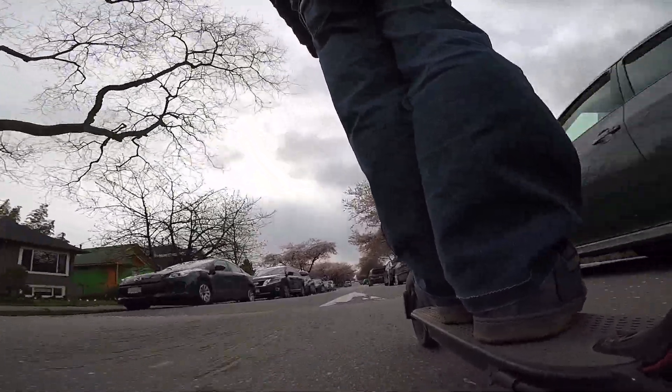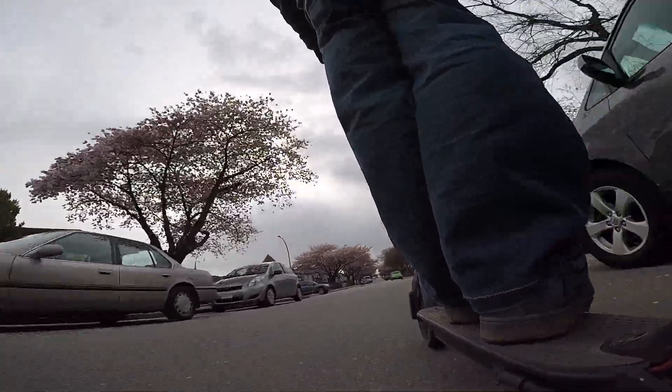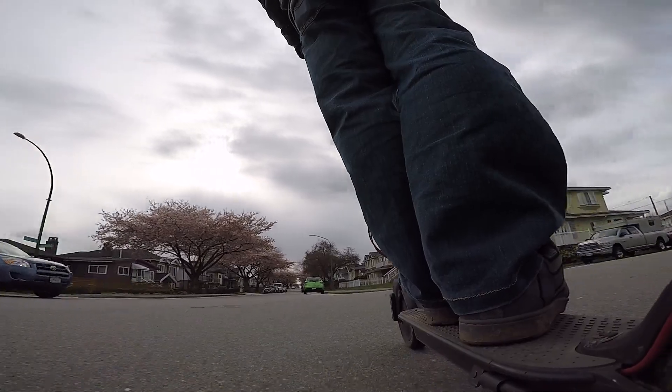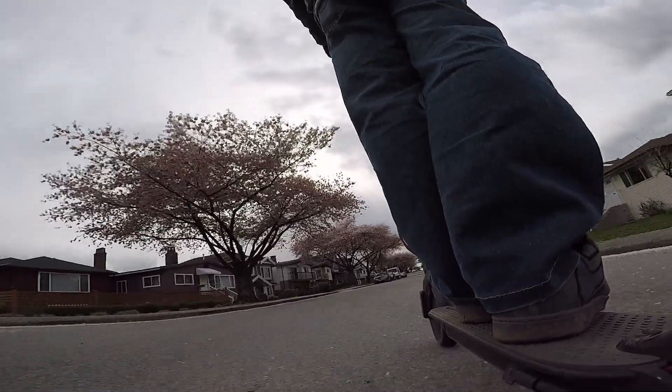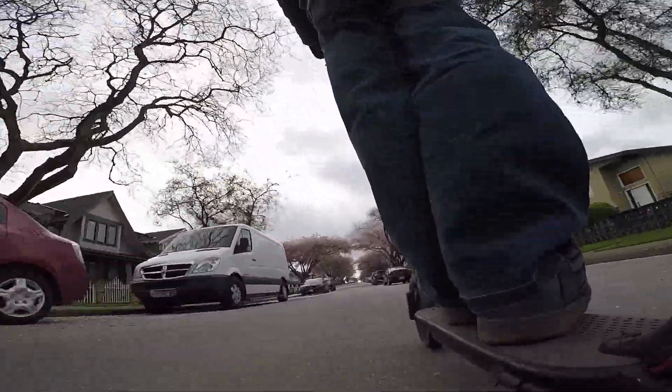This next problem has to do with spot welds breaking off the battery terminals. This has happened to me, and the first thing you'll notice is a large, sudden decrease in range. I have a bunch of videos related to the problem and how to fix it, so you can check those out. The problem is mainly caused by riding on rough terrain and trying to do jumps and tricks with the scooter.